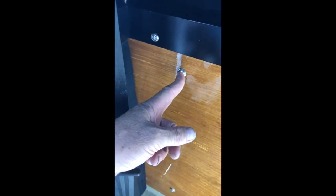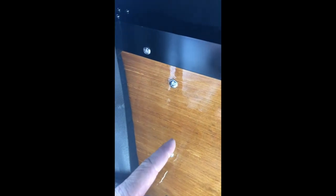I put the aluminum angle in, put my panel in, marked it out so the holes line up outside the aluminum bed wall but inside the fiberglass quarter panel — so they're in this cavity and aren't exposed to the elements. These actually go into rib nuts — just quarter-20 rib nuts. I did three down each side, put it in, and found I had a little bit of pucker in the middle.